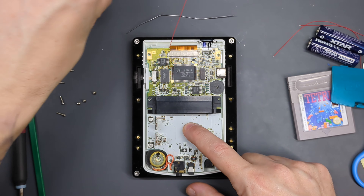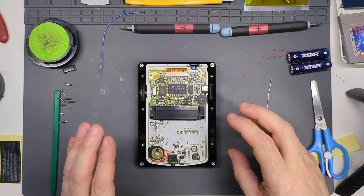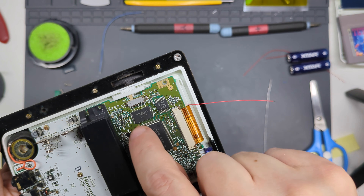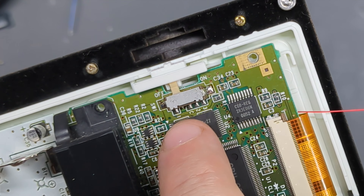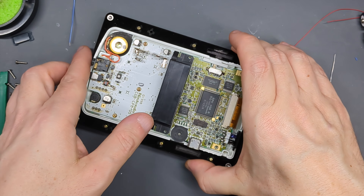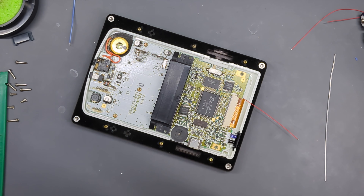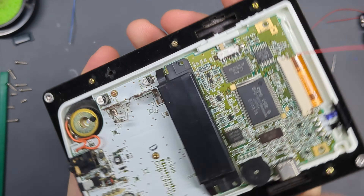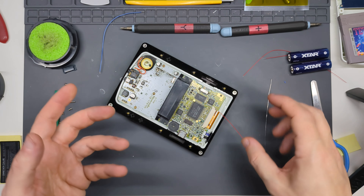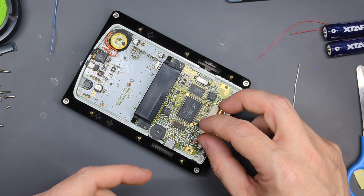I'm going to use the three screws. The bit we need to solder to is where the other end of the wire goes — on the switch. This is where you're getting into a little bit more of an awkward area. You've got four connectors in a row: Mark 3, 2, C, and 1. C is the point we want to connect to. Your switch may still have its original solder from 1998, so it might be worth adding a little bit more. It's about tinning those surfaces — the end of your wire is already tinned, so you just need to tin the C point on the switch.